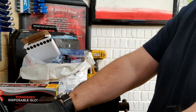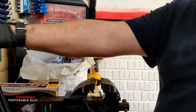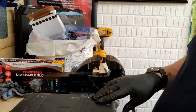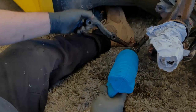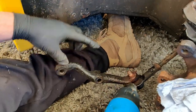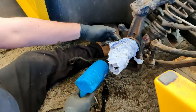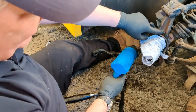And then everybody's happy. There you go, and everything back where it should be, so that when you come to start again, all your tools are in the right place. What we've got here is the control arm. These two bolts go behind this upright. One goes to the bottom of the brake caliper, and the other one goes through that bolt hole there.